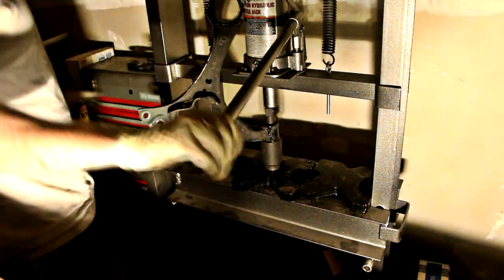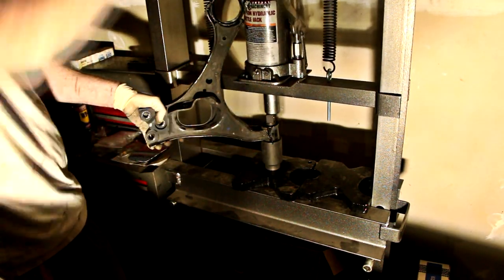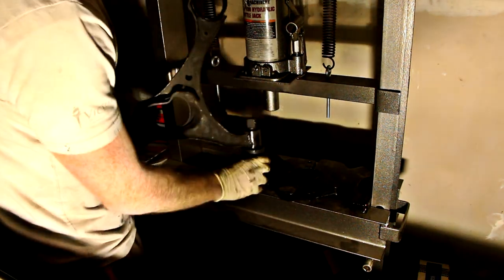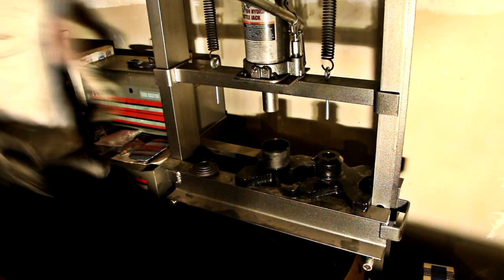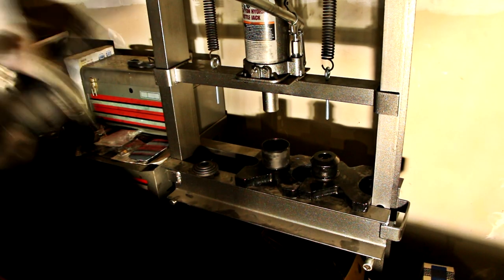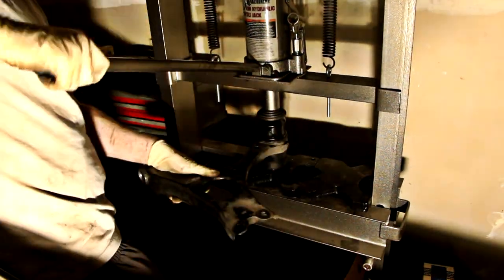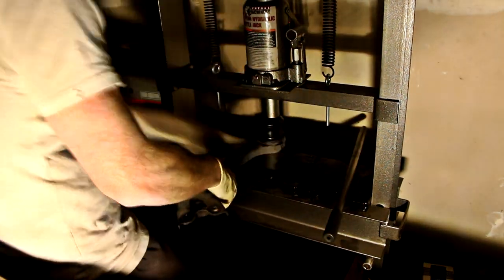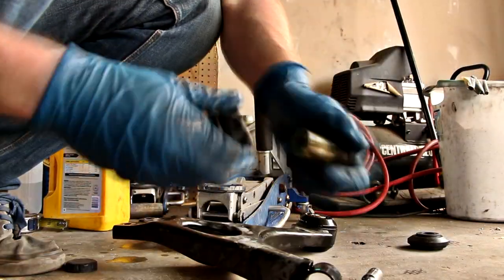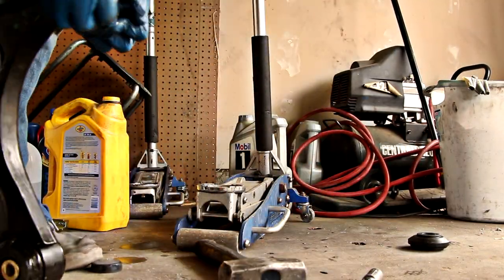I used one of the larger axle nut sockets and mounted the control arm underneath the press. For this one, I ended up using a large impact socket to press out the bushing, since none of the press tools in the AutoZone ball joint kit were quite the right size. Now the control arm has had both OEM bushings removed — time to install the new ones. The rear position bushing is in two pieces so they just slide in. However, the front position bushing does need to be pressed in. I had one hell of a time trying to do this. Eventually I realized the trick is to put a large weight over the bushing and then use the press — that large weight evenly applies pressure, preventing it from slipping or going in crooked. For the rear two-piece bushing: slide one piece in, insert the metal collar, and tap in the other piece with a mallet.